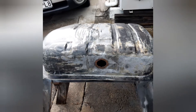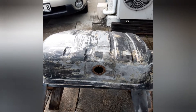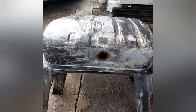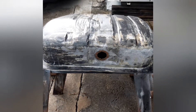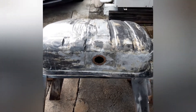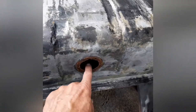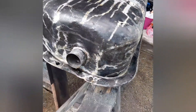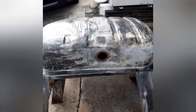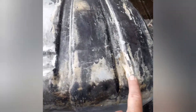Inside the tank was very rusty and it looked like it had a previous coating of tank sealer - there's just like a rubbery goo - or it might have simply just been petrol varnish. It was very tarry inside, so I set about last weekend cleaning it out. I bought some CLR-type product, washed it out, and pressure blasted it, getting the pressure washer inside the holes to give it a good blast out and get rid of any loose stuff.